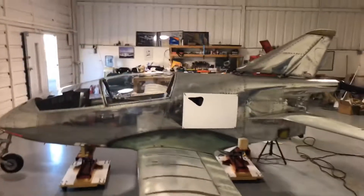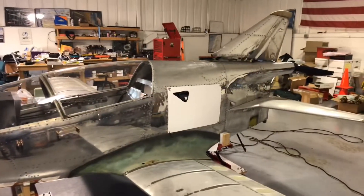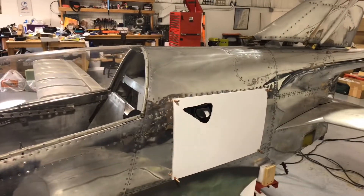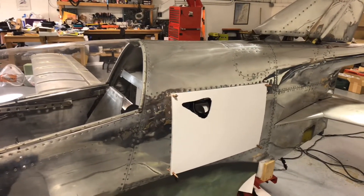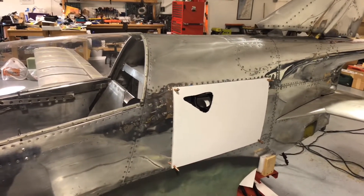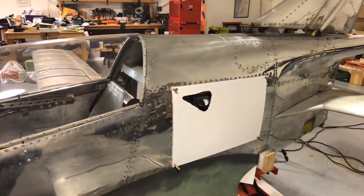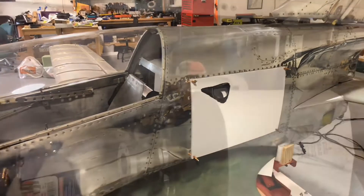There's the real first look at what that'll look like with that little teardrop NACA duct sitting at that angle on the plane. Of course, that'll be a polished piece of aluminum — pretty cool. Looking right down into it, I've got to design the top of that enclosure for the engine so I can baffle the wind out over the cooling fins properly. Viewed from the inside, it looks like this.